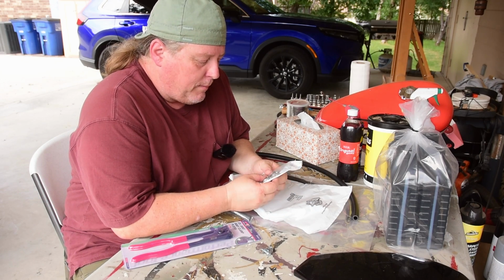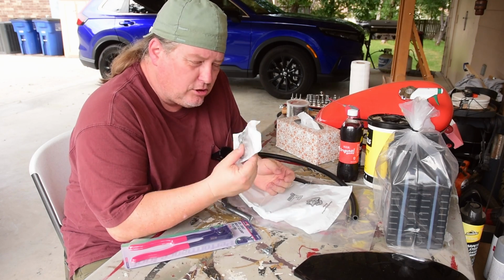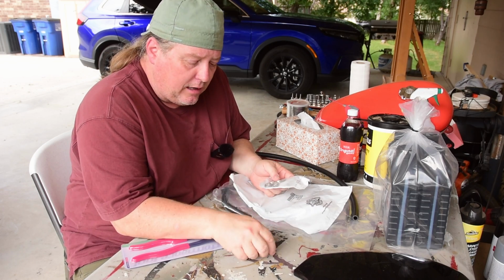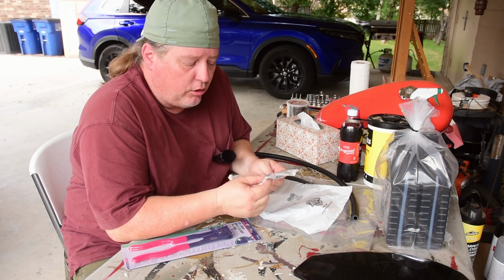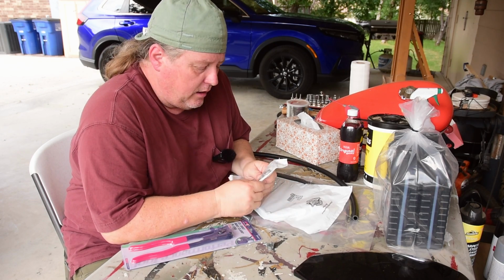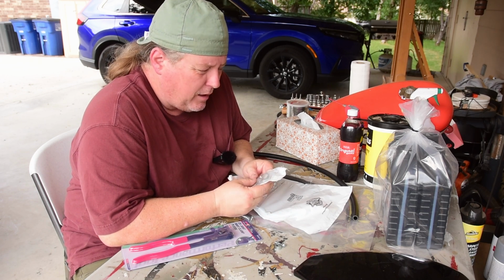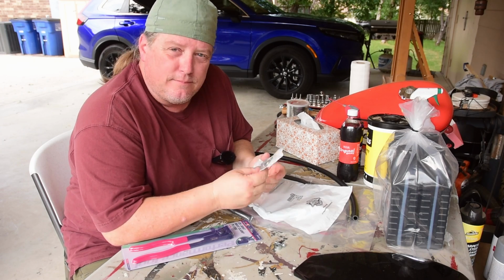This is kind of one of those situations where my propensity to default to whatever the engineers say to do, the people that designed this and built this, these are the clamps they use from the factory, which is why I went ahead and purchased them. But they were kind of pricey, and I don't quite understand why I couldn't use just a regular hose clamp, the kind you screw together. There are several different styles, because these are a pain to get off, and in the field, if anything goes wrong, I basically have to destroy the clamp to get it off, and I won't have a clamp other than a zip tie in the field, though I will probably stash a few hose clamps in my toolkit, extra parts kit. So I'm defaulting to the factory, but I'm not understanding why these are better. Maybe some of y'all can leave a comment down below to tell me why. But that's what we're going to be doing.